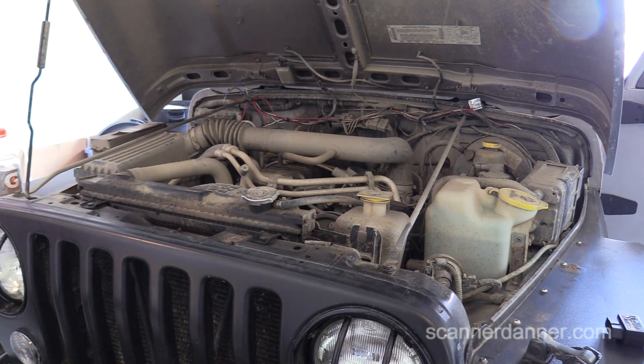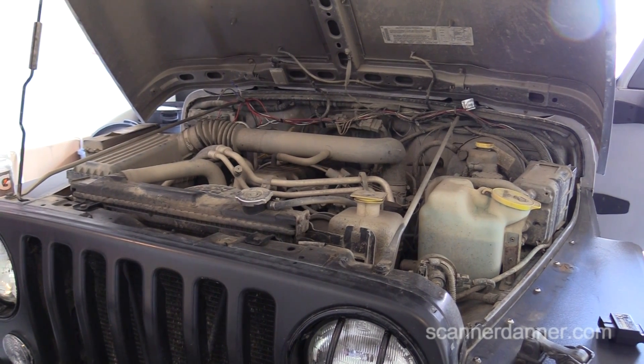This is after installing the new starter. Go ahead and try it, Greg — see if we have a happy crank. That was pretty standard procedure for diagnosing a faulty starter. Make sure you're checking your main feed and your control with the key in the crank position. Make sure you're checking your block ground. For those of you that need more help, I'll put in the description some other videos I've done on checking block grounds and other bad-starter cranking type videos. Thanks guys, I'll catch you next time.